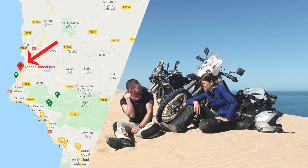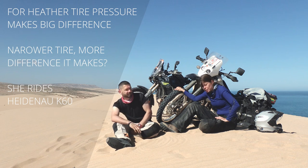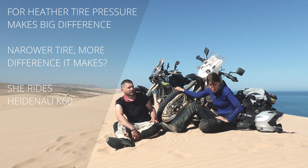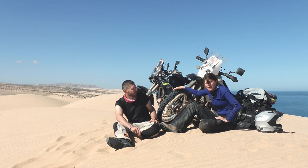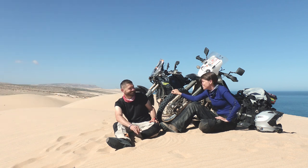So what did you do before you hit the sand yesterday? Probably the biggest thing for me was tire pressure. I have tube tires so I could go to a relatively low tire pressure, and before I started the trip I actually added rim locks so I could go even lower. If you have a big ADV bike you probably don't have the option for rim locks, but if you have something more like a dual sport like this, you do. That means you can have very low tire pressure — mine is single digit right now, low enough that my tire pressure gauge won't read it.